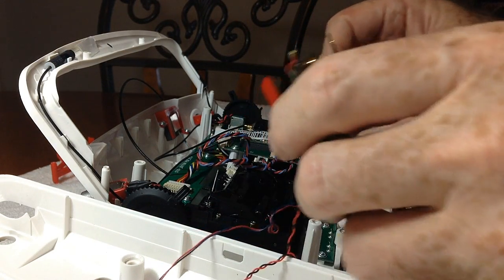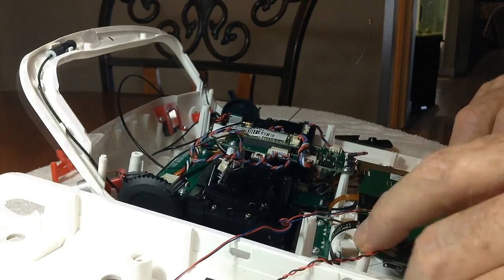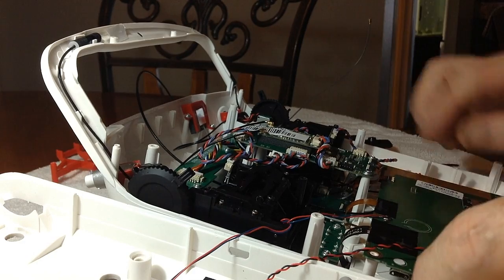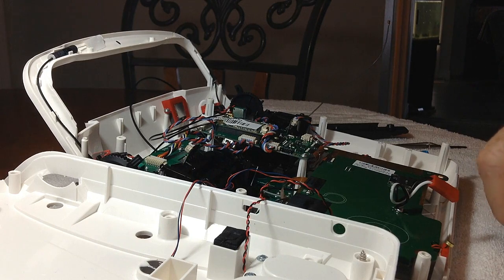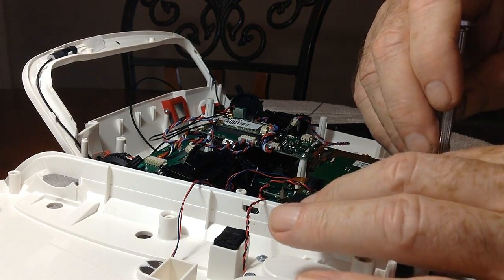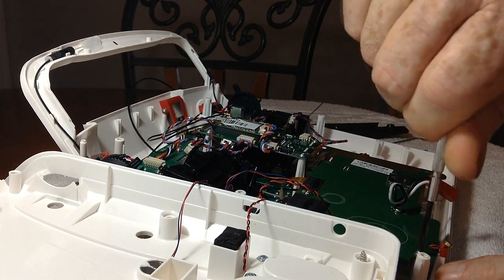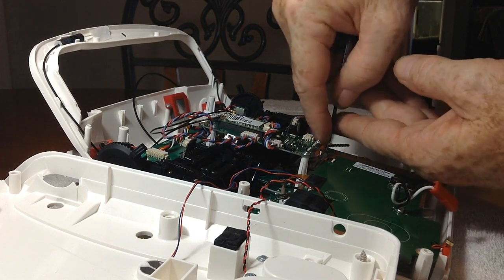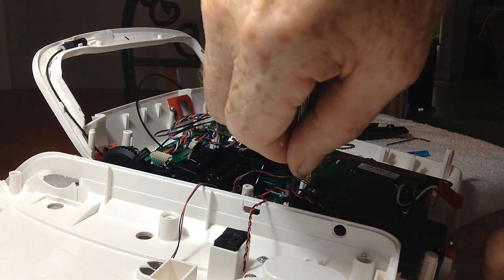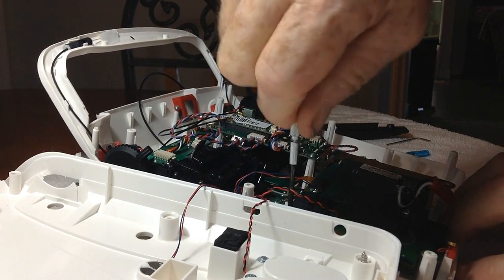We're going to flip this Wi-Fi board back over and put it into place. Just be real careful with those ribbon cables — keep a visual on them. They're not super delicate, but I can see where if the board is stressed or pulled a little bit, they might come loose. I'm going to line the corner holes with the posts that the screws go back into and put the screws back in the Wi-Fi board to secure it down. Remember: there are spots for four screws, but by default it comes with three — in my case, the bottom right was absent. Making sure I'm getting them in without cross-threading anything, nice and snug without over-tightening. Don't want to risk damaging any of the PCBs.